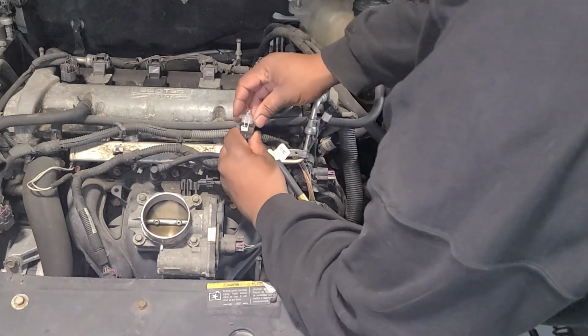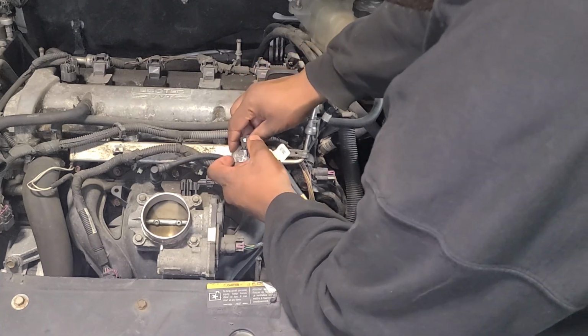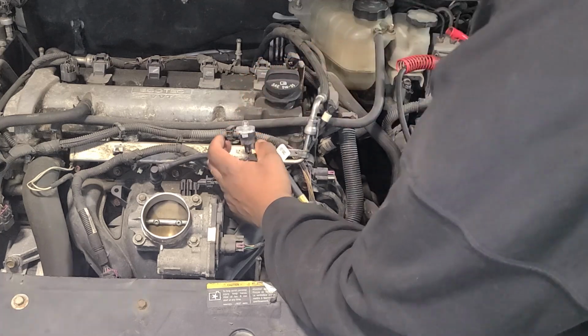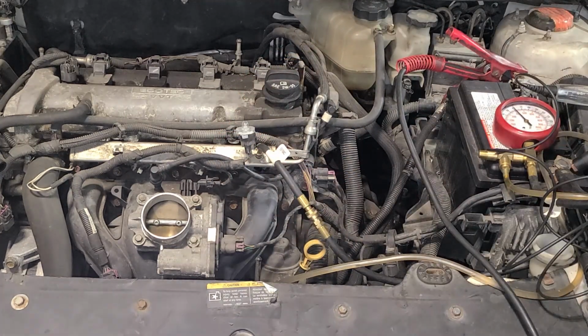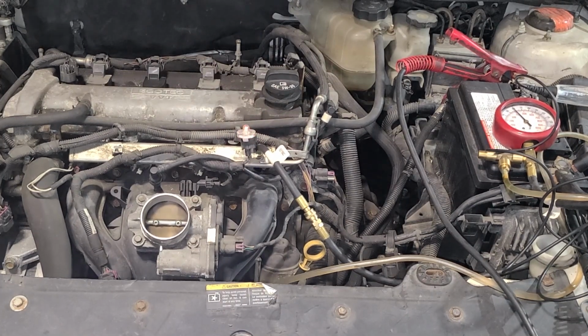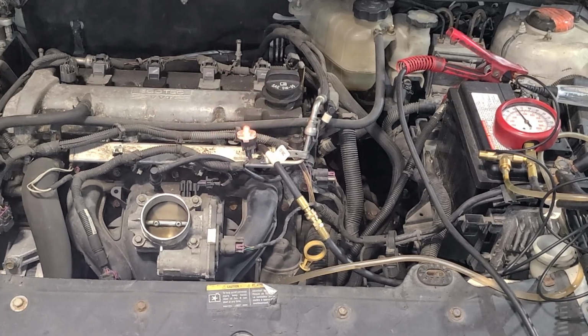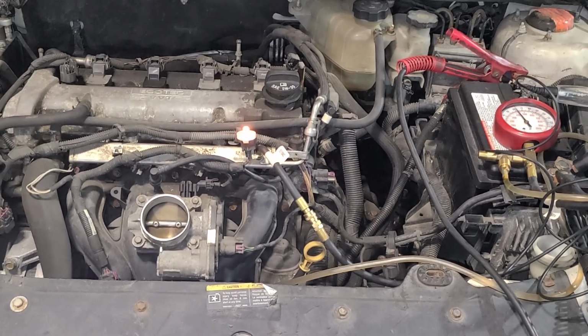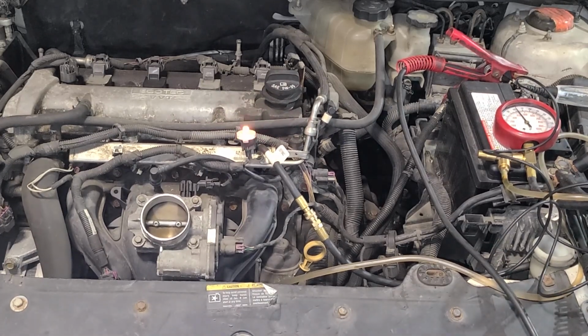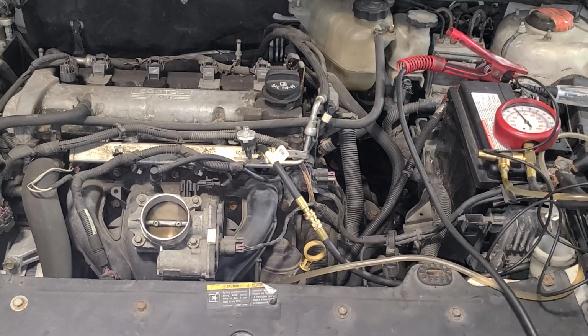and see, because that's our injector plug right there. So if that isn't plugged in, you definitely won't have injector pulse. So it's running. Hallelujah. Let me cut this thing off. So you gotta be kidding me. That was the problem the whole time?